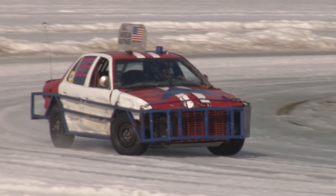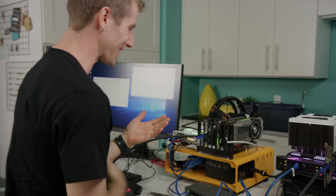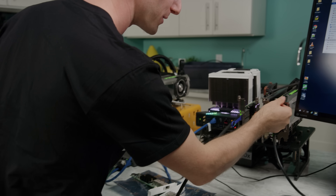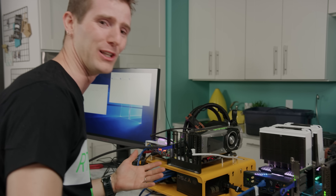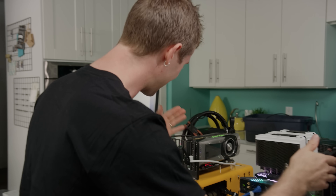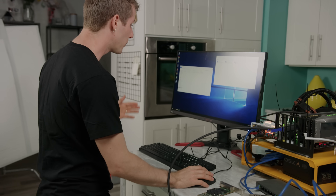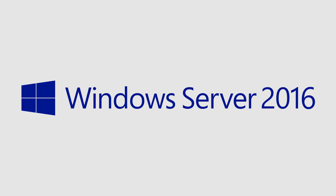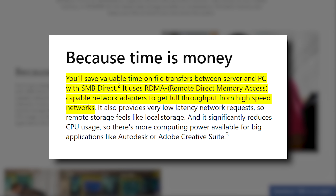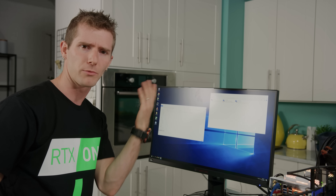Today's video is about how to go fast, not about how to put on your seatbelt. I never thought I would see the day when the GPU in a gaming rig is the lowest priority PCIe device sitting at the bottom of the board. For our OS, we had to go with Windows Server 2016, because as much as we wanted to try Windows 10 Pro for Workstation — which is supposed to support RDMA, the tech that allows for these super high-speed transfers — it just didn't seem to be working for us.